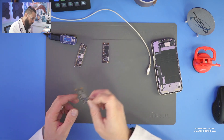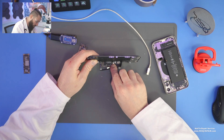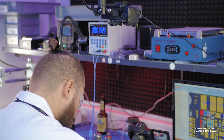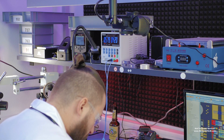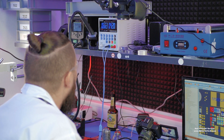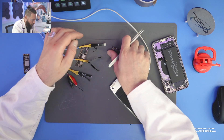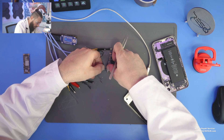This is the donor board and this is the right board. We just connect the screen and then connect 4.2 volts battery voltage to emulate the battery and to boot up the board. We connect this and then we boot up the board by just bridging these two points here. A second before I checked and we had a half backlight situation and normal boot.